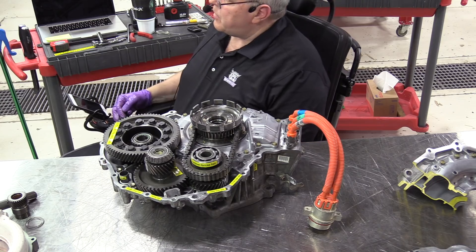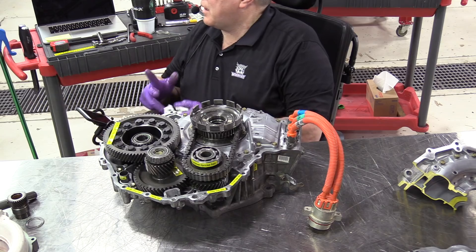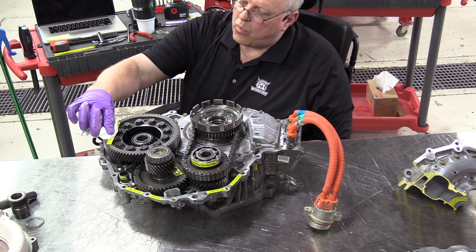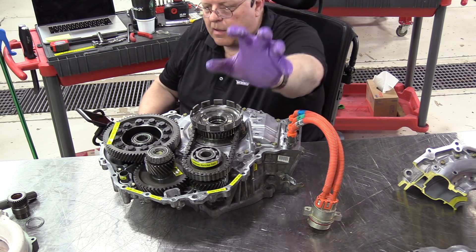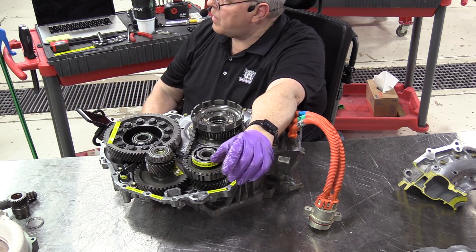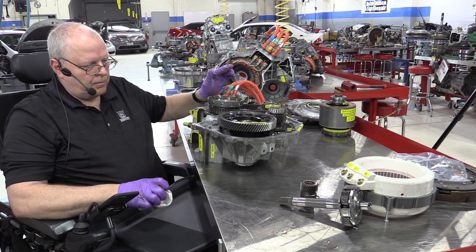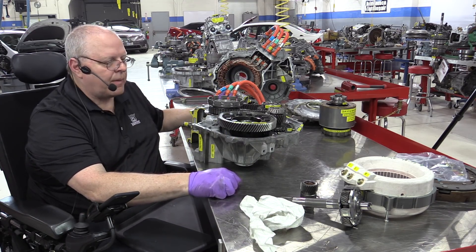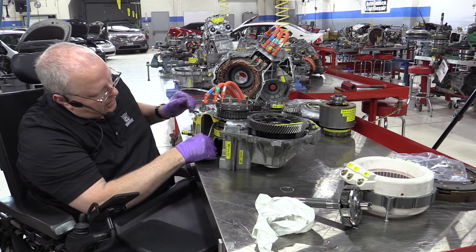We have a regular open style differential here to allow us to turn corners, and that fits in there just like that. So we have four gear ratios to take into consideration when we calculate the overall number of rotations that the MG2 rotor has to make in order to get the tires to turn one turn. The tires turn the same speed as the final drive ring gear. Before we go any further, we've got to understand a few things.